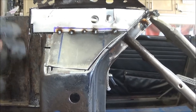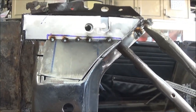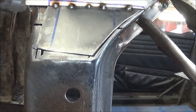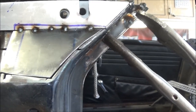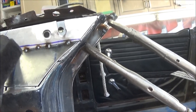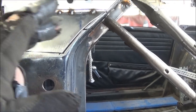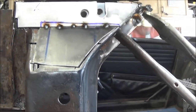We're making pretty good progress — you can see I've got the patch fitted in there and just sort of tacked along that top flange. We have the cutouts for the bolt holes, looking not too bad. I need to do a little trimming on this side here to get it to fit — it's a little wide there — but not a problem. Anyway, I'm pretty happy with that patch, it fits in there pretty well. We're going to spray the inside with zinc primer and then go ahead and weld it in.